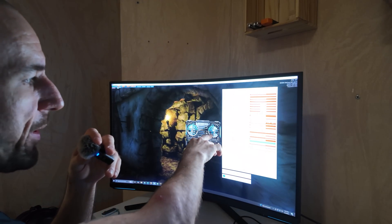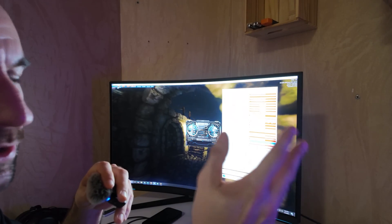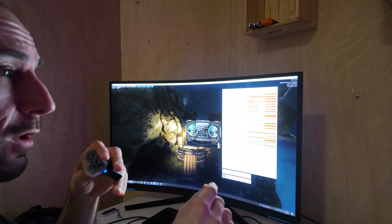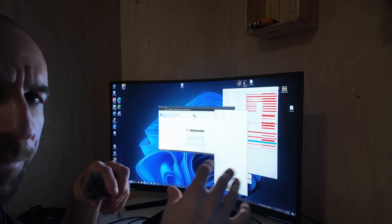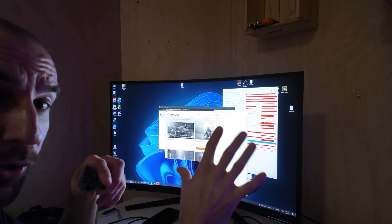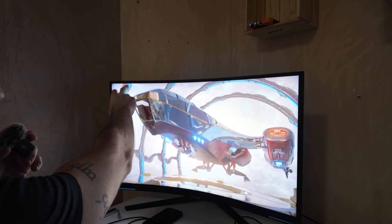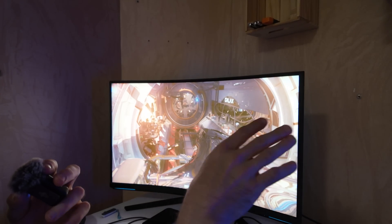On this card, we're actually limited by temperature — it's hitting about 80 Celsius at about 250 watts, even with the PCIe slot bracket cut out. The cooler does struggle to cool over about 250 watts, but that doesn't seem to matter too much. We're hitting a consistent 3200 MHz. In max overclock mode doing Port Royal, we're hitting about 270 watts and the card is not throttling at all. Power limit is not an issue on this model whatsoever.